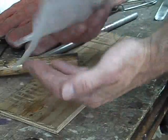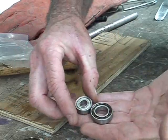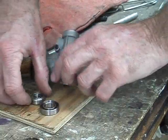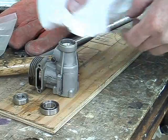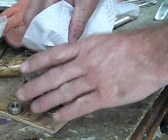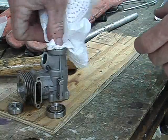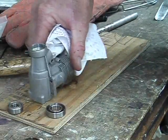Here are the new bearings, ready to go. There's a front bearing and a rear bearing — the rear bearing is open and the front bearing has shields on it. Now we must put the bearings in, starting with the front bearing. If your crankcase is still hot it should go in quite easily. First, clean up the inside where the old bearing was — you'll likely find a little bit of varnish, carbon, and residue that's worked its way in over the years. Get rid of that so the bearing can be seated properly and not go in at an angle.